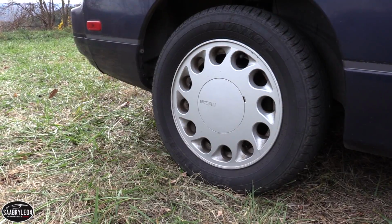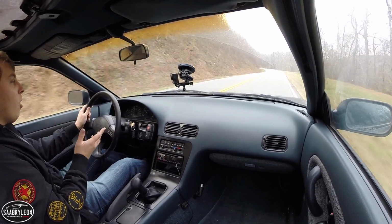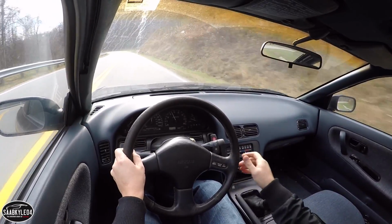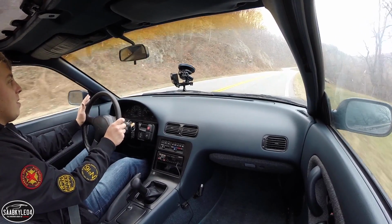So with the wheels, I also want to upgrade the brakes. I'm trying to keep all of this on a budget, so I'm probably going to just focus on the front brakes and then upgrade the factory setup. And what I mean by that, with larger wheels, I can fit larger brakes. I'm thinking about maybe 13-inch rotors up front, and then keep the same size at the rear, just change out the discs, maybe something slotted or whatnot, better pads, because I do want to add some power